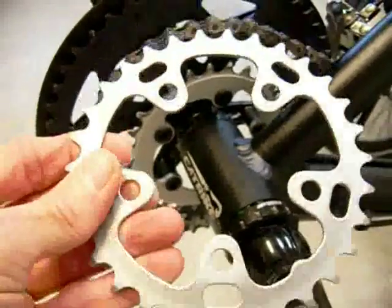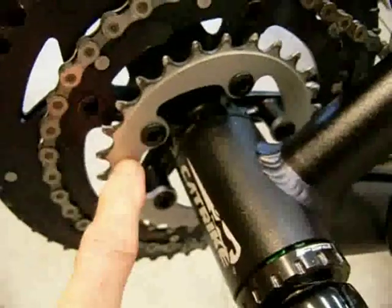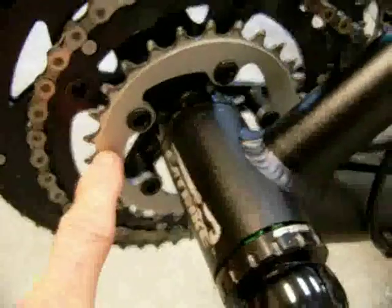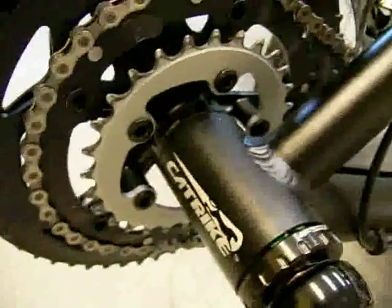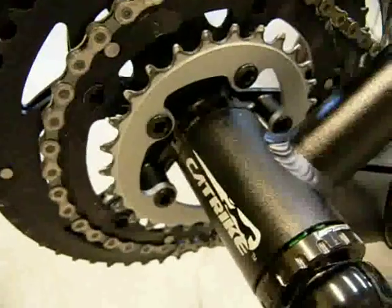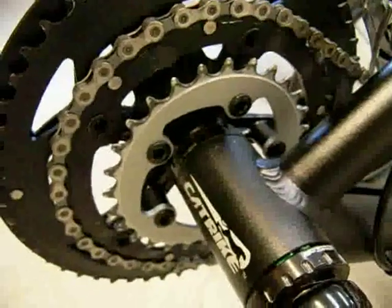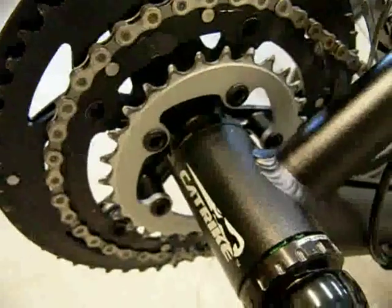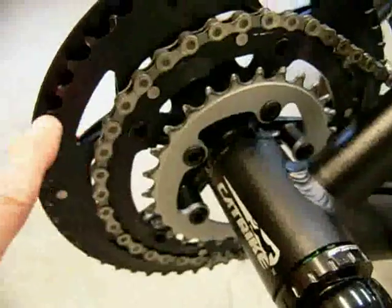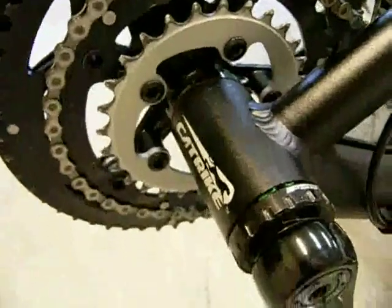If you're going to go up any serious hills, you don't want this. So what I've done is put on a 28-tooth, which is fine most of the time — it really gets me up the hills well. The only drawback is if you're touring with a heavy load, you might want to go to a 26, which I'm actually contemplating for this trip up to the Columbia River in August. So basically I have a 28, 39, 52, and the closer these are together, the easier the trike shifts.